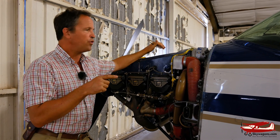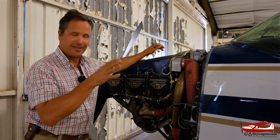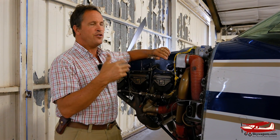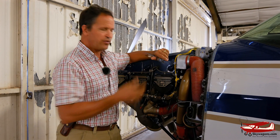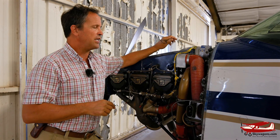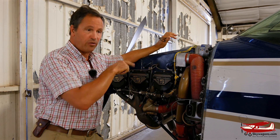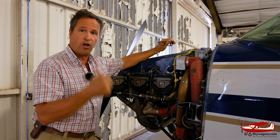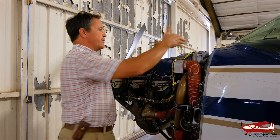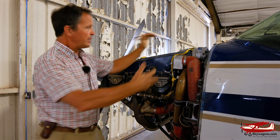The engine uses about four horsepower to turn the supercharger to make the energy it needs — like a perpetual motion machine, but the real energy input is fuel and air. At low elevations you'd be at around 24 inches of manifold pressure and the supercharger is barely online — there's a knob inside to turn it off. But at altitude, say taking off out of Colorado, you can get to 28 inches of manifold pressure with a belt-driven supercharger. The oil in its bearing is not pumped from the engine — it's self-contained and cold. No need to idle it on the ground.